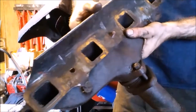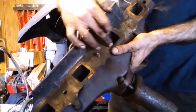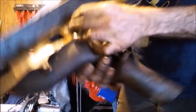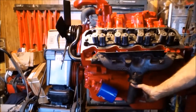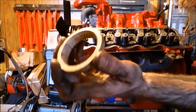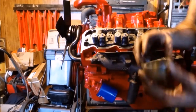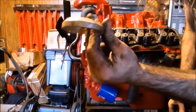We're going to put our gasket on here. We want to put high-temp copper all around each port on the gasket, on the manifold, and on the exhaust ports. Use copper anti-seize on the bolt threads. Once the exhaust is on, we'll slip our pipe up here, slip the flange on, and in between we'll have this new gasket that came with the kit. What they originally came with was a steel one — that's the one you want. The included type doesn't last very long; ours blew out on the way to a show.